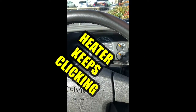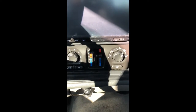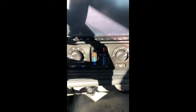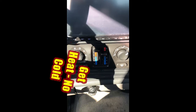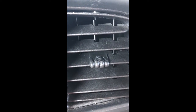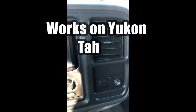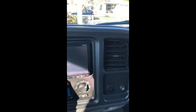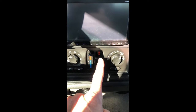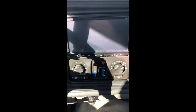We're in a 2004 GMC Yukon and the HVAC system sometimes will mess up and you'll get a condition where you want heat but you're getting cold, or you want cold but you're getting heat. You might hear this kind of sound — it's a clicking sound coming from the little step motor that lives back behind the grill. It's supposed to turn according to where you put the settings, but the motor just keeps trying to turn. It's an easy fix.